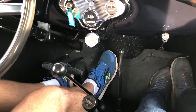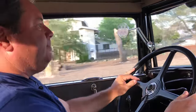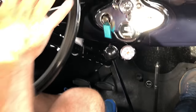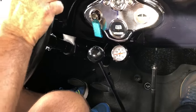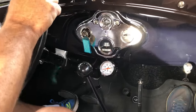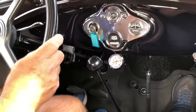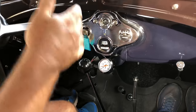Coming up, we're going to be going on a really long downhill. I'm going to show you how I can go down that hill without ever touching the brakes once — that's the key to staying off the brakes. As I get ready to go down this hill, I'm going to downshift to second and let the engine braking slow the car down. I'm not even touching the brakes. Even if we do start to pick up a little speed, I can just get on the brakes for a short second to control the speed, but right now the engine's doing all the braking. We don't need to go 50 miles an hour down this hill — this is a residential area — so we're just going to creep down it nice and easy without even touching the brakes. Look, my feet aren't doing anything — they're just holding the ends of my legs up.